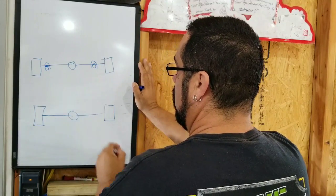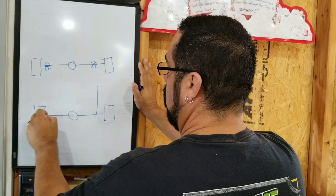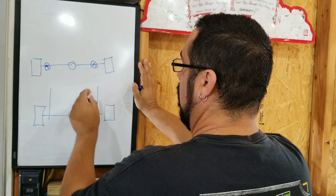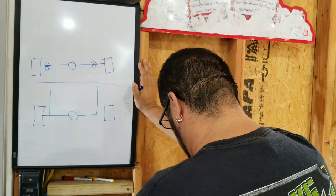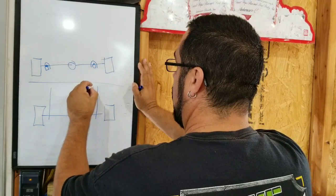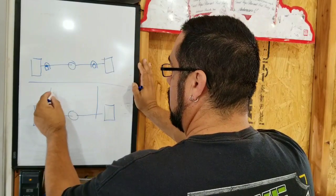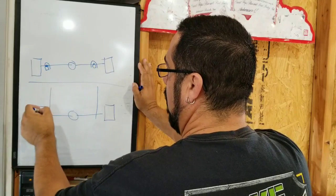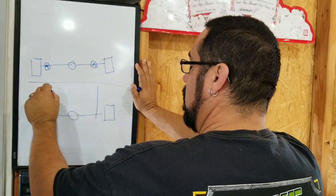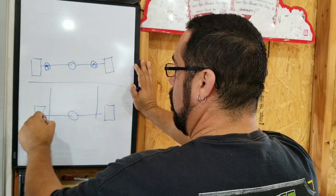You have a two-link: it connects here and here. There's basically a square under here, and you've got a U-bolt that goes up and over the axle that holds it on from an aerial view. Your frame rails are either going to run on the inside with your C-notch coming up and over, or it'll be on the outside — either way, your frame will be right over the top of it.